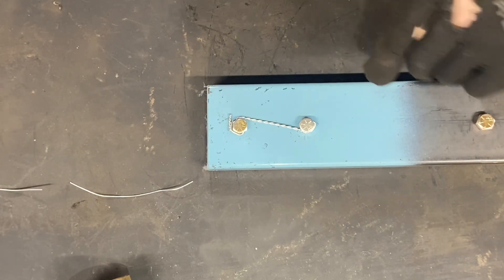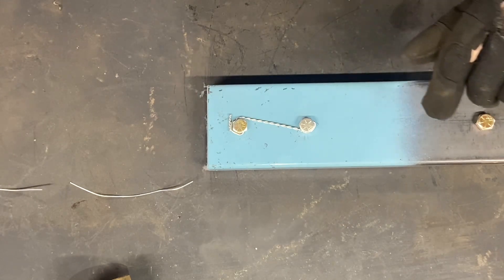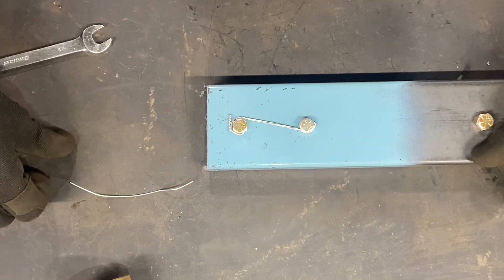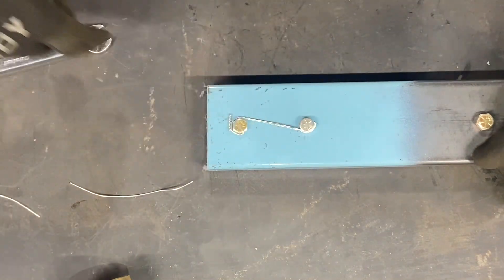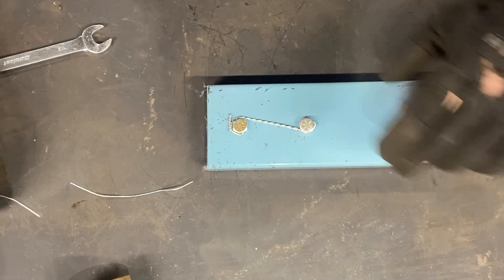You won't lose a wheel, you won't lose a rotor. It's just a good way of adding extra safety to keep two bolts together. You can continue this through further — you can actually keep one wire and loop it through numerous bolts if you want to. I like to do two at a time.